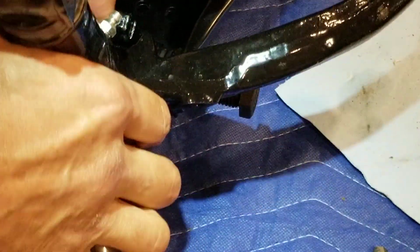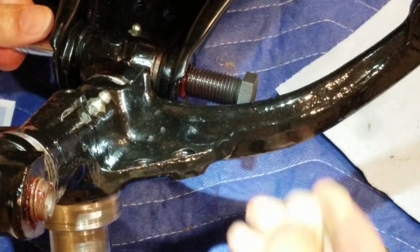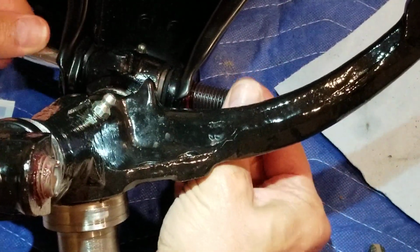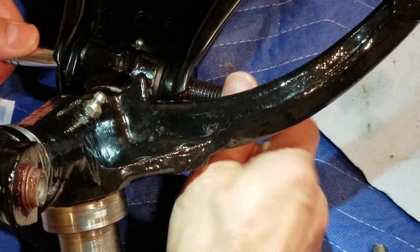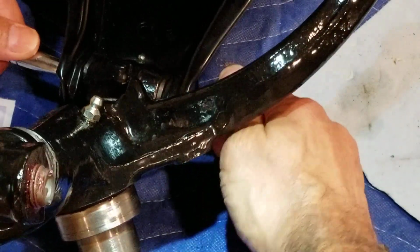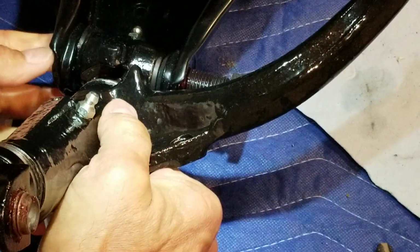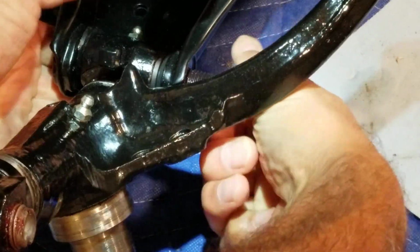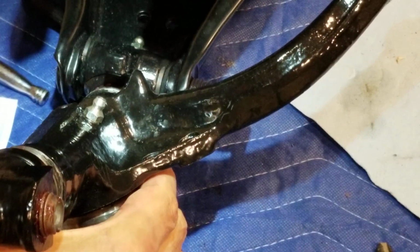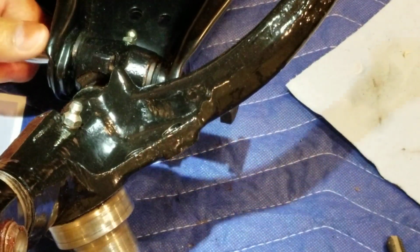And that seal right there, that second seal, it's not cooperating 100% at the moment. I don't want to damage the guy and then wait another 2-3 weeks until a new one comes in. So at this point I'm holding it with the ratchet handle and slowly threading this guy in from the other side. But right now I think I reached the point where the seal is being squeezed and it's out of place. I may have to pull everything out again and just kind of find a sweet spot.